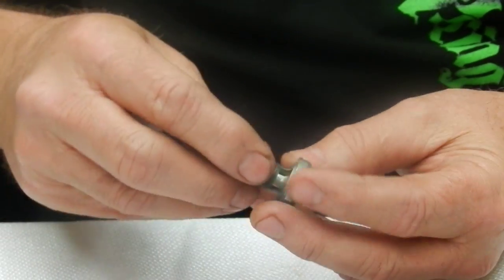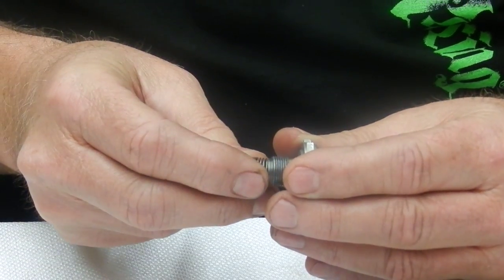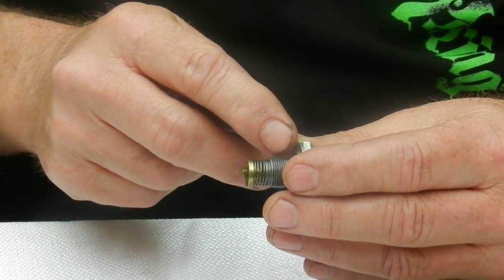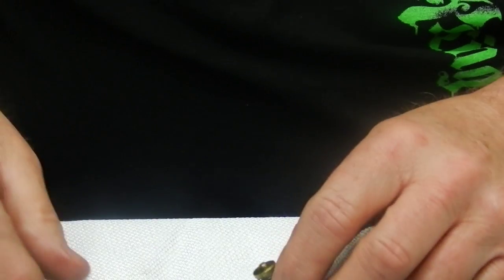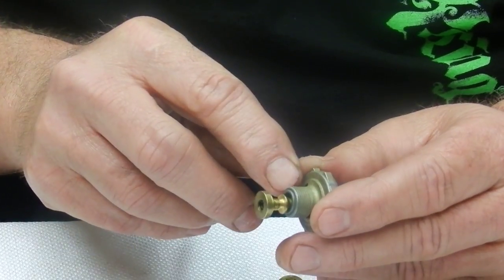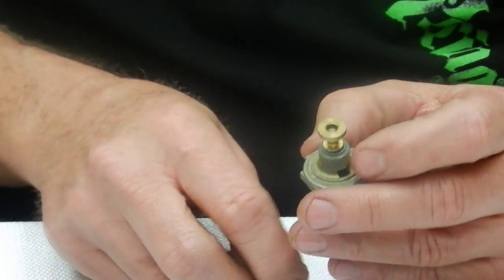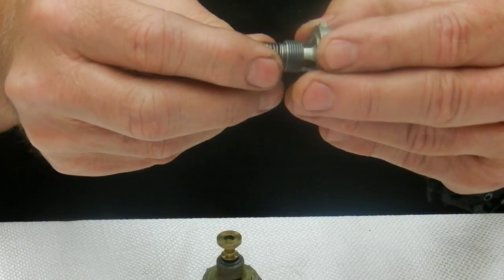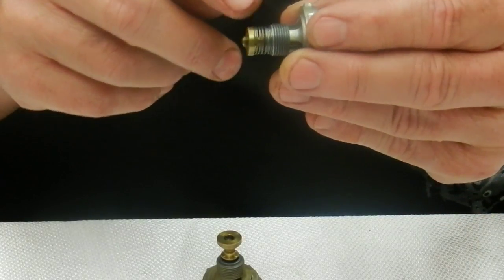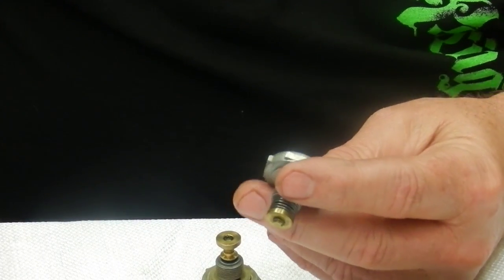A lot of people don't realize that the old ones had a real tight bushing in here with very little flow through the stem area — actually through the housing where the stem goes through. It's got to have that extra clearance to allow optimum flow through the full window. If it had a tight area around that bushing, it wouldn't flow — no matter how big the windows are.